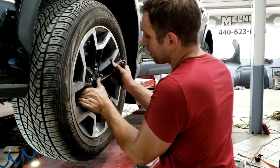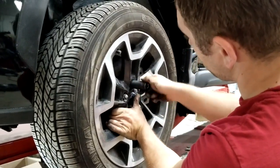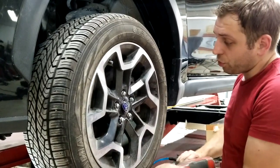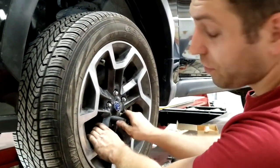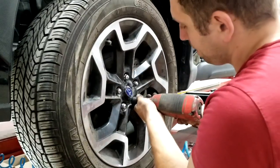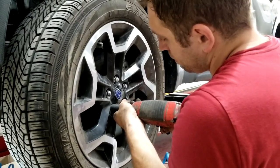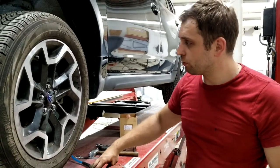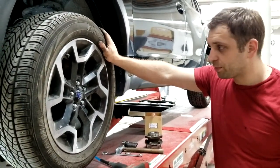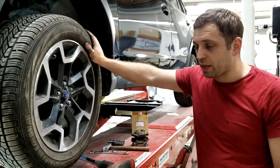A very important step: grab the wheel, make sure it's centered, and get it as tight as you can by hand first. A lot of mechanics try to be quick and take their impact gun, put it on, and start driving the lug nuts right away — and if the thread is slightly off, they screw up the studs and then you have to replace the studs. You want to go in a criss-cross pattern. That's it for this video — this was George with Melnix Automotive. That's how you change the wheel bearing hub on a 2017 Subaru XV Crosstrek. This procedure works on other Subarus — it's pretty much the same setup. You don't have to have impact tools to do this job; it just takes a little bit longer by hand. Thanks for watching, have a great day.